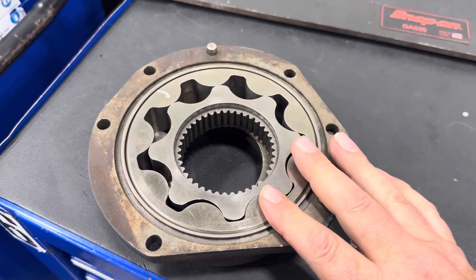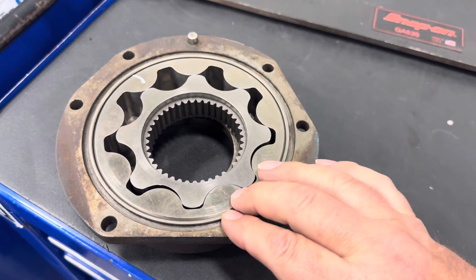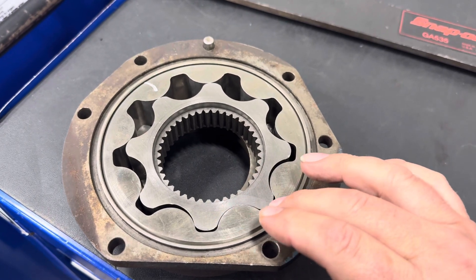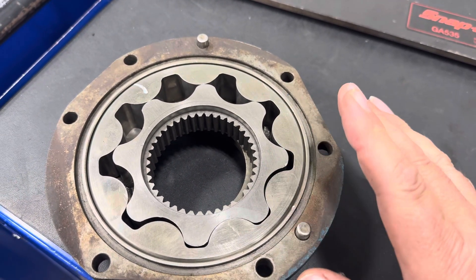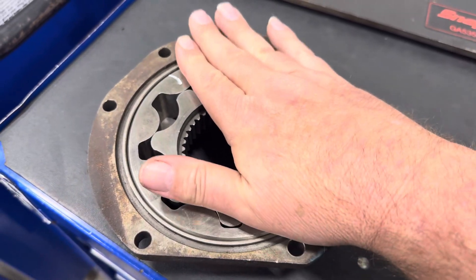The pump can also be one of the reasons for a loss of oil pressure, because like all pumps, they will start to wear internally. As the clearances get bigger inside the pump housing, you'll start to leak between places that you shouldn't. When this one is installed it should seat up against the block, and you shouldn't have too much leakage across this face.